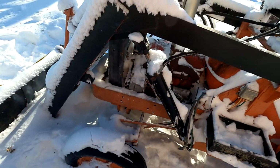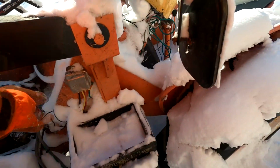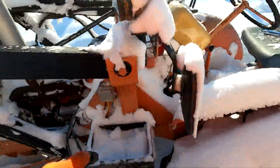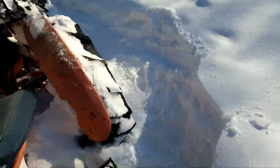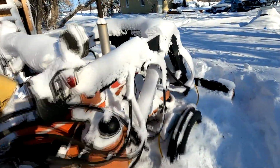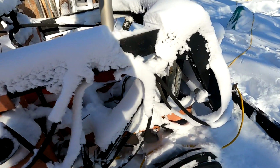Oh, you got a modern GM 12 volt alternator off there. She's been converted. That's stolen off an old GM truck, I'm pretty sure. Oh, this is hand welded and handmade by my great grandfather. He welded all of this stuff together and built this thing. You got the two reservoirs for your hydraulic fluid, but this thing's never had hydraulic fluid in it, period. This thing just uses ATF because it's cheaper.